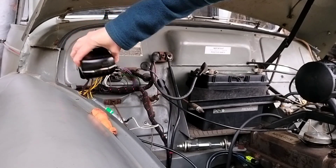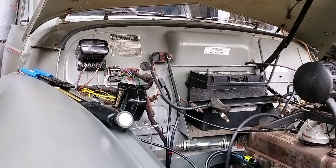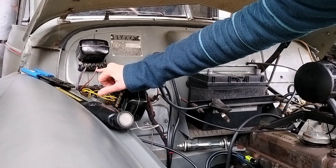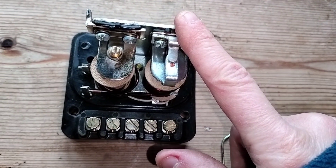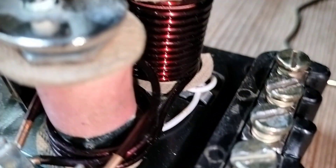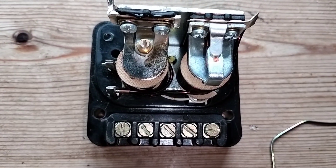Before swapping the wires, note that our kill switch is off, which is why our battery is connected. Even if you have a kill switch, you could also disconnect the battery to be absolutely sure. The first wires are quite thick — particularly the brown one — and they can get a bit scrunched up, so if you've got enough room you can get a new piece of wire ready. Looking at the unit we took out, you can see the cutoff on one side and the regulator on the other. The points on the regulator side are burnt out and are actually shut — it lasted a whole 10 miles.